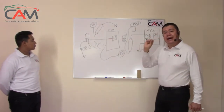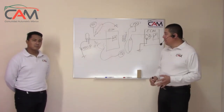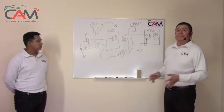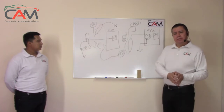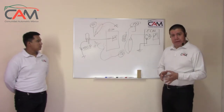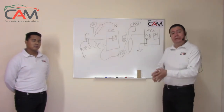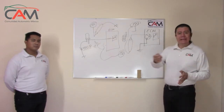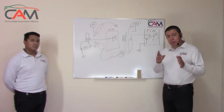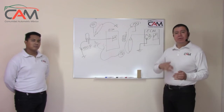With this LED and resistor circuit connected to ground, I crank the engine. At that moment the LED should start to flash, indicating sufficient energy to activate the power output stage and there should be spark. Be very careful: a common mistake is swapping coils when one cylinder has no spark. It is very common on Nissan for a coil to be blown with no visible signs of damage. If you move that faulty coil from cylinder 1 to cylinder 2, you will damage that output too, and the same will happen on cylinders 3 and 4. I strongly recommend not swapping coils.